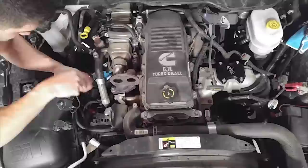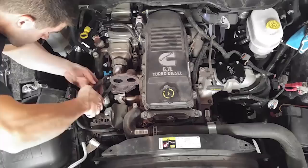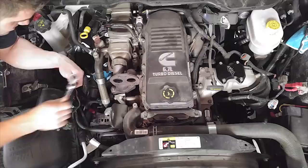Back to how the EGR works: after the exhaust is recycled it comes back out the exhaust, which increases your EGTs. You always want cooler EGTs because high EGTs are bad for your turbo. The turbos sit really low on these trucks — almost underneath the passenger seat — but the exhaust enters the turbo, spools it up, and you get power.